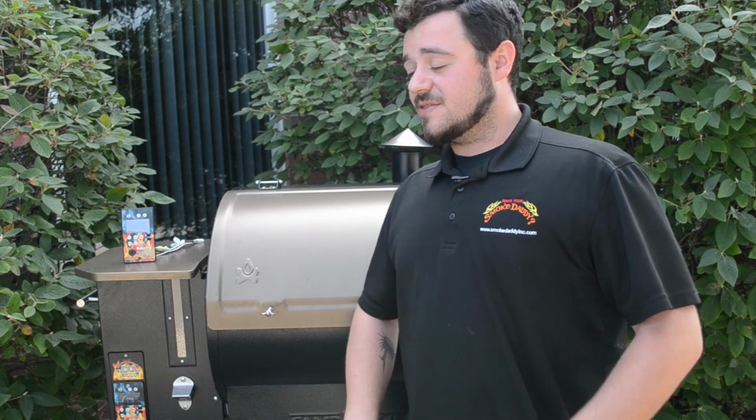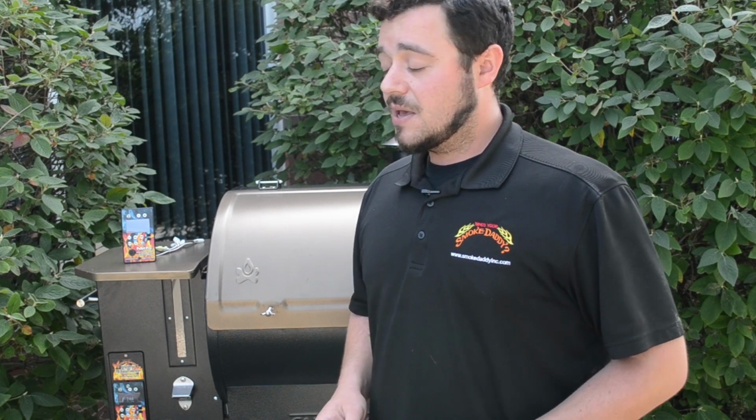I'm here to explain the differences and the benefits of switching your stock controller to our new Pellet Pro Patriot PID controller with Wi-Fi capability. Now, being a PID controller, it's going to maintain your set temperature typically within 5 or 10 degrees of the set point.